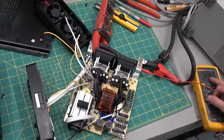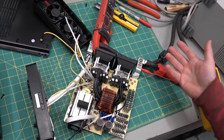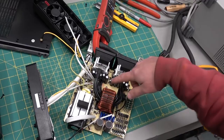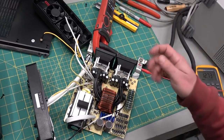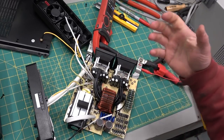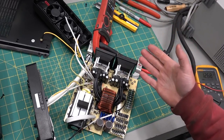So we'll go ahead and let this drop down — it should level off at 12.6 volts. But I'm going to let the battery sit for a bit, because charging creates oxygen and hydrogen gas in lead-acid batteries. When we connect up, all these capacitors — when you first connect something, they act like a short circuit. You get a big spark when you first touch the leads, and that big spark could ignite the hydrogen gas from the charging of the battery. So we want to let it sit for a little bit, not for tits and pickles sake, but for actual safety sake.